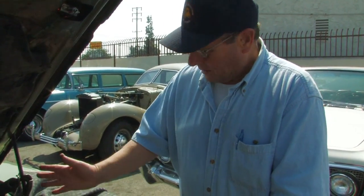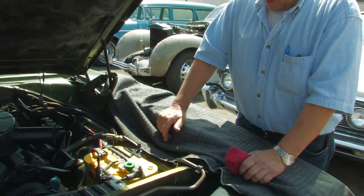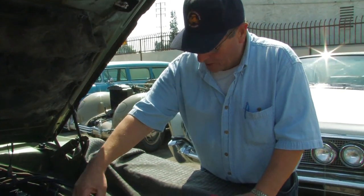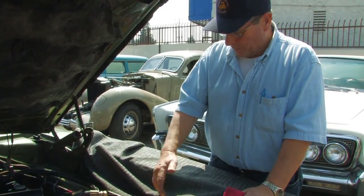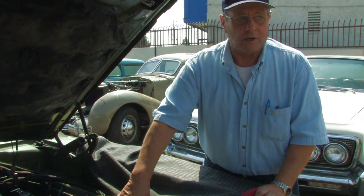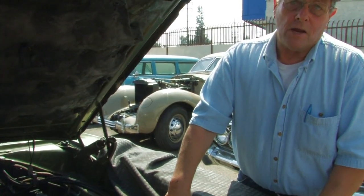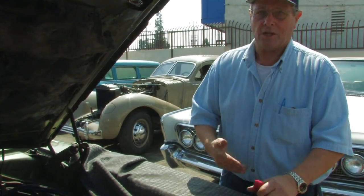The only thing I'm losing is the time on the clock — I'd have to reset my clock, and that's a disadvantage. On some newer cars, you can still use these battery cutoff switches, and they have a little bypass that goes around so you can keep all your presets and your keep-alive memory and your computer going without losing any of that. But I like these batteries because they don't leave a mess, they're much easier to maintain, they work well in extreme heat, and they work well in extreme cold. The only big disadvantage is what they cost.